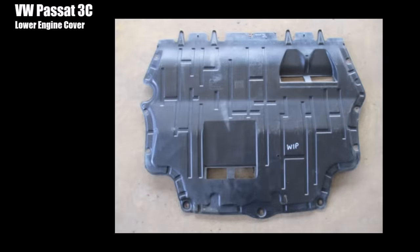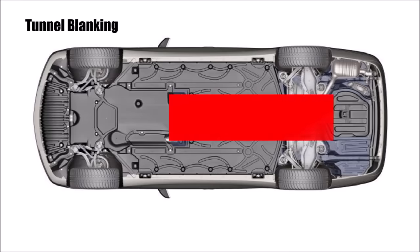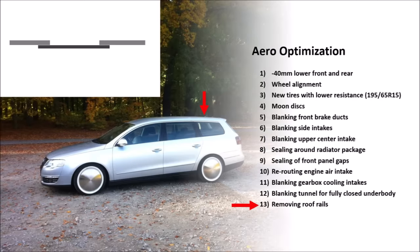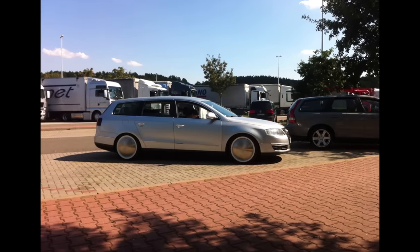The Passat already has a nicely covered underbody, but there were still a few openings. I already covered the brake ducts, but I additionally closed the gearbox cooling ducts, because in my use case it never experiences the high temperatures it is designed for. The tunnel in the middle is wide open to extract some heat from the exhaust, but in my case situations would never be as extreme as in development, so I closed the whole body with a metal plate to have a flat underbody. The next thing that was against my aerodynamicist's honor was the roof rail. I removed it, hot-glued small metal pieces from inside, filled the holes, taped a square tightly around them and sprayed the little squares in silver. The surface was completely flush and you could only see six silver patches that looked like stickers if you went really close, so there was no disturbing roof rail anymore and the car looked lower and longer.